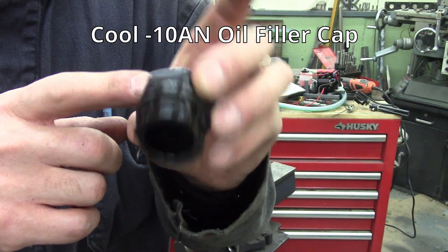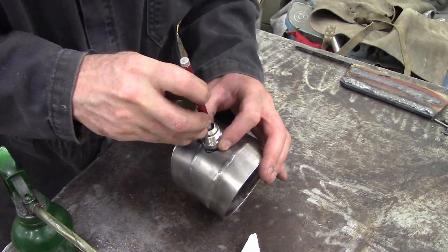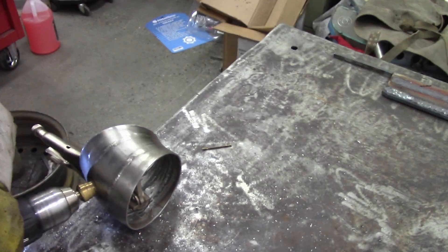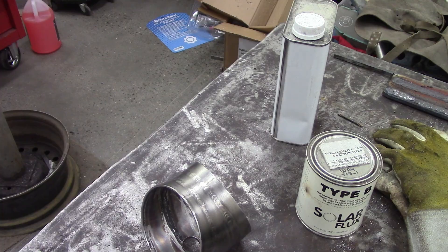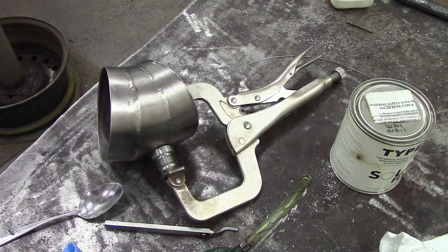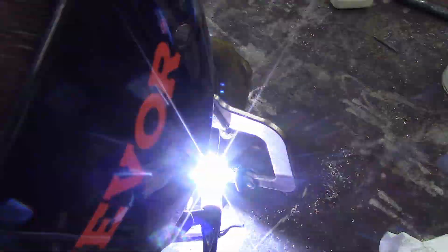Here's the fitting — you want to have some kind of fitting like this. I thought this was genius, but it actually sucked. This oil cap is designed, I think, for one or two pins, and it isn't on the valve cover, but whatever. The slight elbow that I made — I drilled a hole and bought a dash 10 stainless AN bung that I could weld into it. This just positions the air filter just enough that I can actually close the hood on this truck. So it's all stainless — this is a four-inch piece from the stainless exhaust. Instead of back-gassing, I'm using Solar Flux, which is a bit pricey but definitely handy. We TIG weld it together. I am not the best at TIG welding stainless, so if it looks less than satisfactory, it probably is. But I'm okay with that.